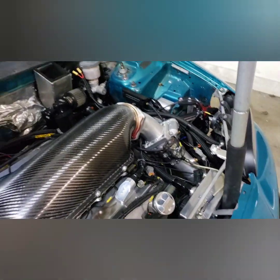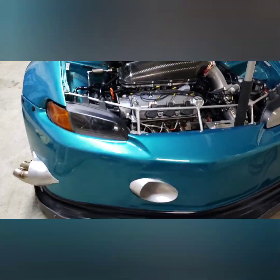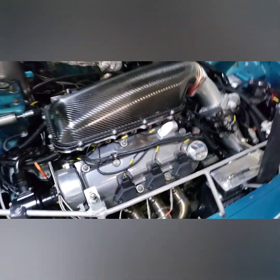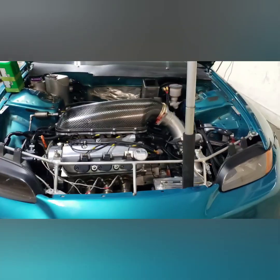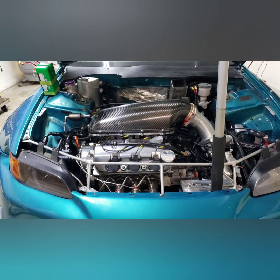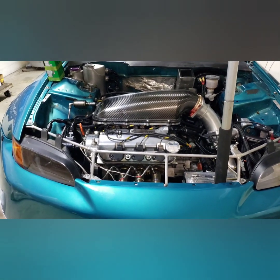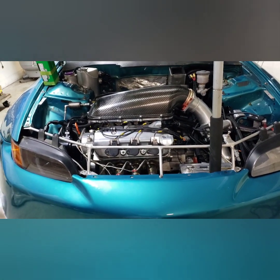So why would you do it? Your injectors are going to be a little more stable. Even though I have a mechanical fuel pump, I have electric fuel pumps that feed my surge tank deep down in there, and the pump runs better — you have more volume, everything's a little more happy. If you're not a street car, why have an alternator? If you have problems with belts flying off because of a v-belt design or a pulley problem like I do, 16 volt makes a lot of sense. Street car? No. Race car? Yes — if it's track only you have time between rounds to charge.